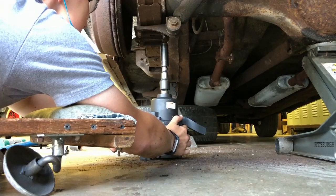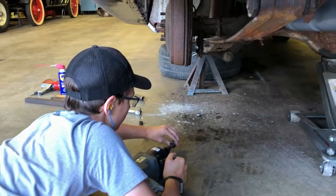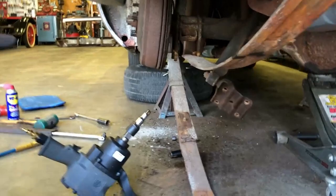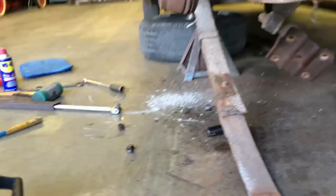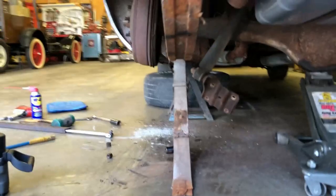That's good — up a little bit. One more to go. You can see we got the U-bolts off, and the spring that was already broke broke the rest of the way — this is why we're changing it, there was just nothing left to this side. This is why you should always inspect all your suspension for cracks and broken parts, because you don't want this happening going down the road.